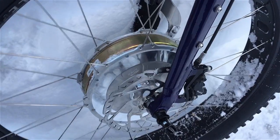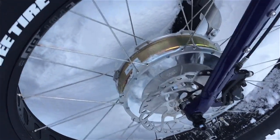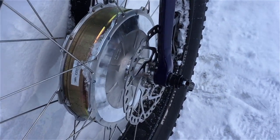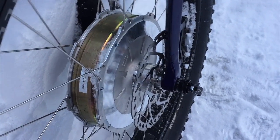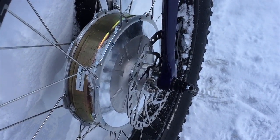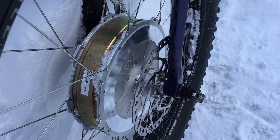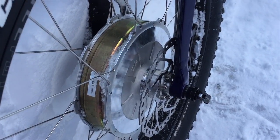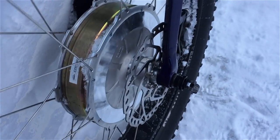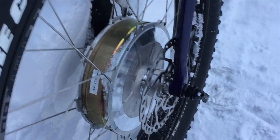For this application, I'm planning on using the motor at least a little bit most of the time. This is the only motor I'm aware of that actually works with axles like this, and for a direct drive motor that can do regenerative braking, it is thin, light, and low profile. It's in beta test right now, and the one downside is the lower thermal mass — it weighs less and can't distribute heat as much, so there's more chance of overheating. There is a temperature sensor in it, but for winter use I'm really not worried about overheating.